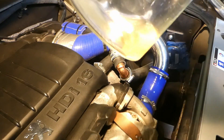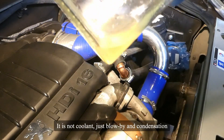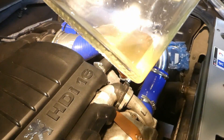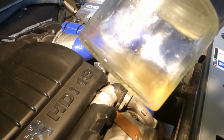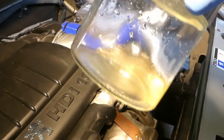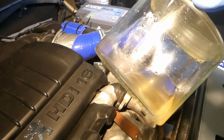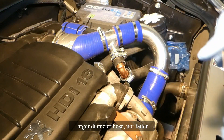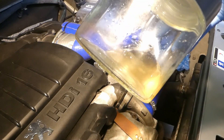So this is really what it's collected — fairly watery, not that much. It's kind of a yellowish watery fluid with maybe a very small percentage of oil. My hose is roughly about 13mm, so if I calculate the volume it's roughly about 60 milliliters of fluid that can collect in my hose. I'll probably have to fit a fatter hose from the catch can down so it will collect more. It really hasn't collected much oil — pretty much just condensation.